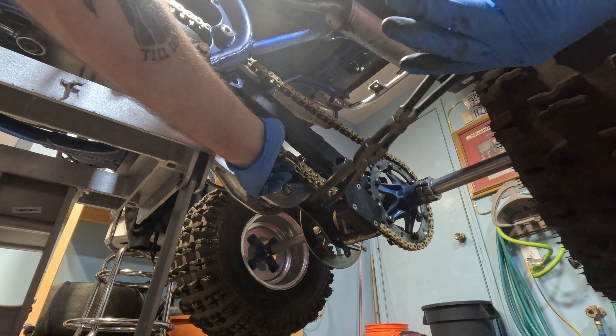Also, another thing — I'm going to put some new spark plugs in there. We're going to try these out and actually gap these properly. These are both at 0.030. They both look pretty decent. I'm just going to run these right at 30. Gap your plugs or get gapped, bud.